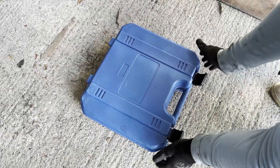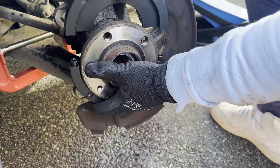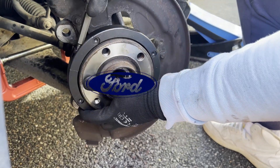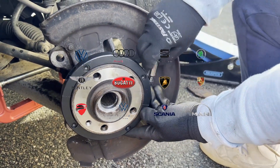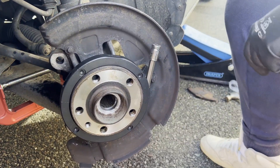There is everything we need for the replacement, to which I will come back later to explain what is what tool. I have the one for the 82mm bearing, which is in some of the Mazdas, Fords and Volvos to mention a couple. There are also different sizes — I believe the VAG group uses this kind of bearing the most, but I may be wrong on that one.